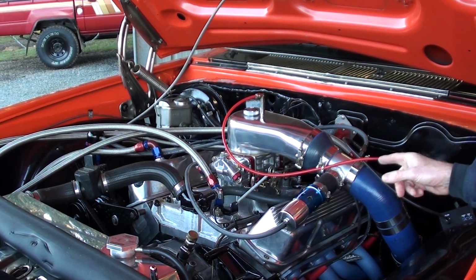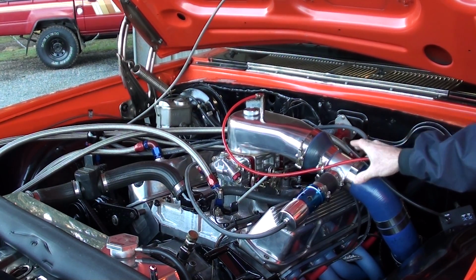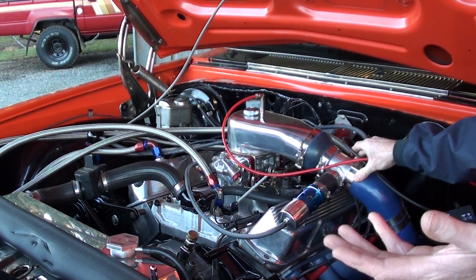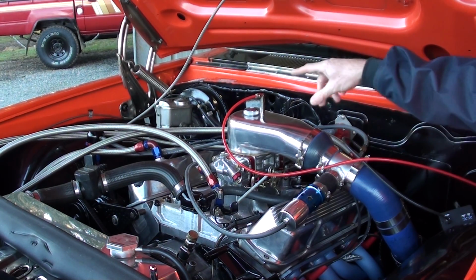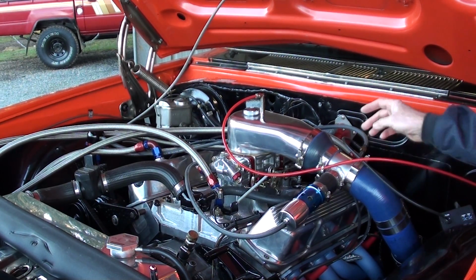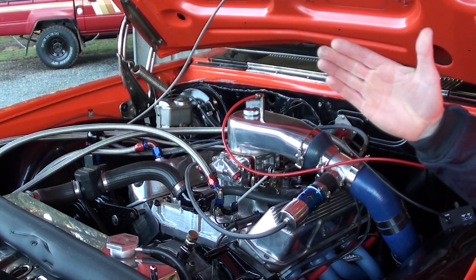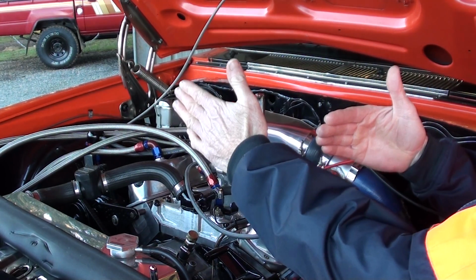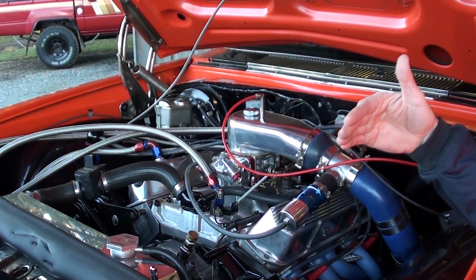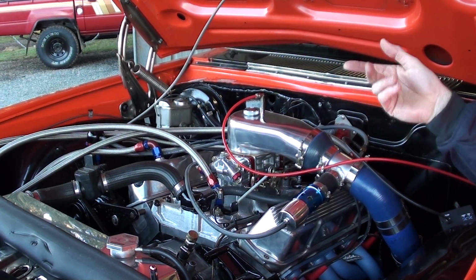That's how I had that first bit of trouble when I did the turbo. I wasn't referencing rising boost pressure to the reg, and I was having a lot of trouble with it. I found out that it just wasn't getting any signal. Even though there's pressure in the pipe, the sheer velocity running by that nipple, or the end of it, wasn't going in. It wasn't enough. So I was running really lean up top, and obviously popping head gaskets.